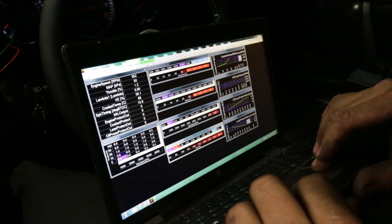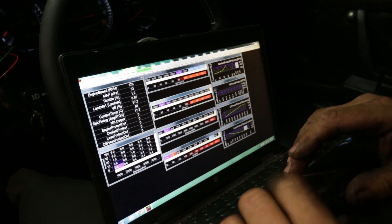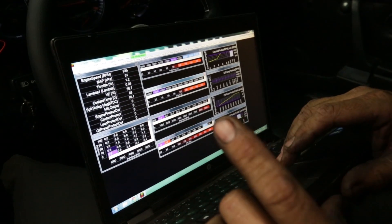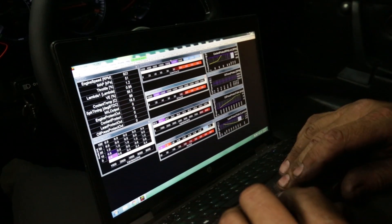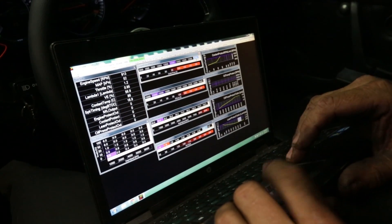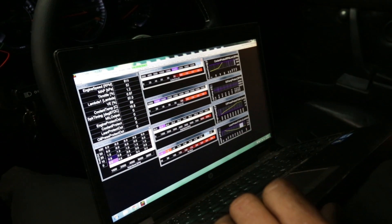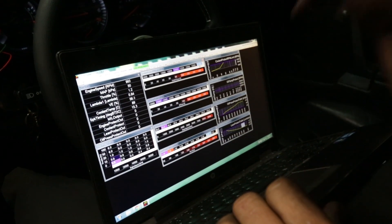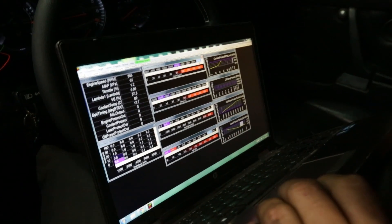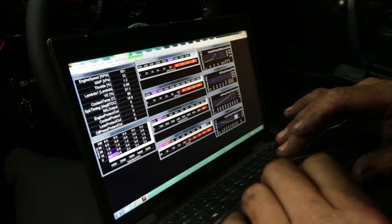I love that. I can do the same with oil temp — I'm not entirely sure we have oil temp on your car — and the same for coolant temp, which is actually what we were fighting earlier. I had this 120-degree data point set as zero, so it was cutting the car because it thought it was overheating. But on our head temp sensor it's not overheating, so we'll have to rescale that to a more attainable number.